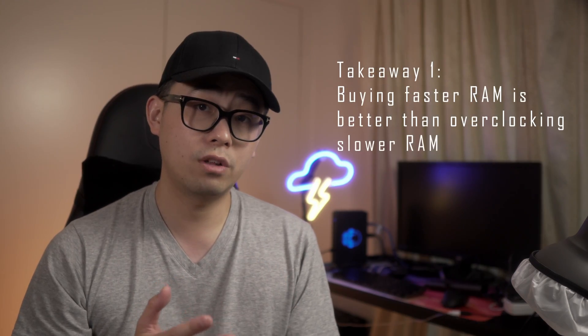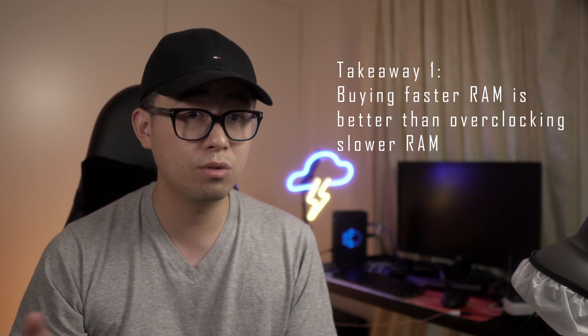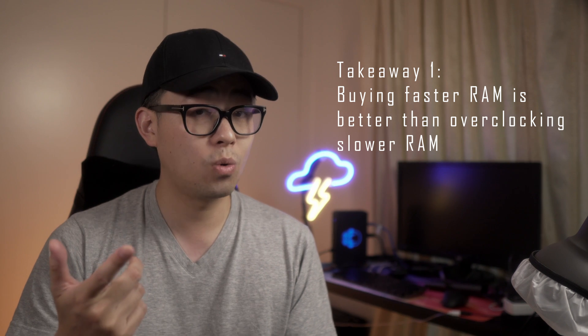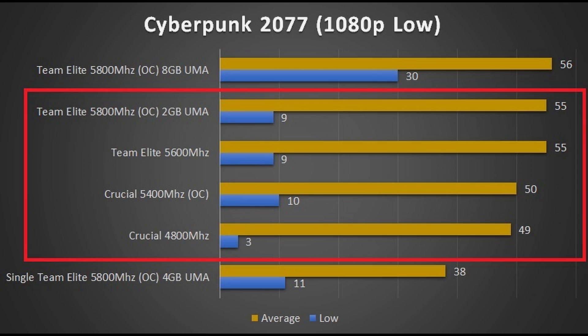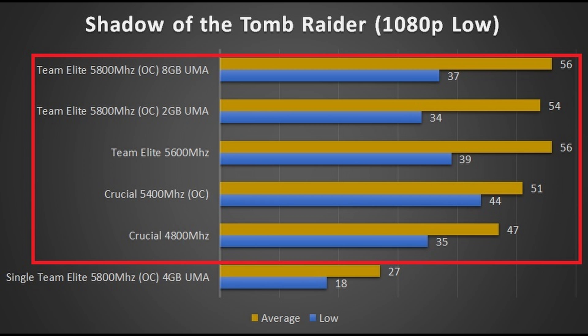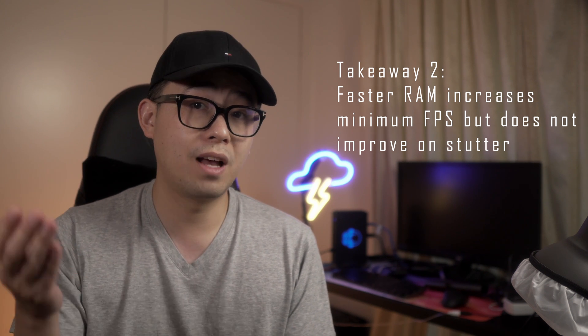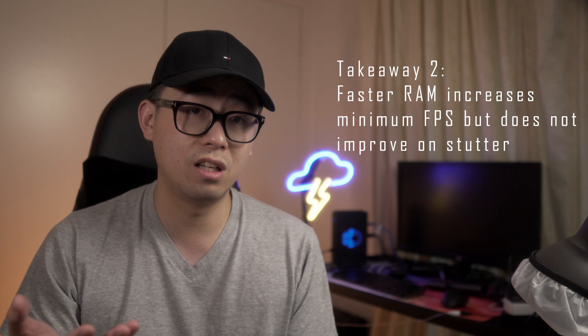In other words, don't expect to overclock your 4800 MHz RAM to 5600 MHz levels and expect the same level of performance increase as buying the faster RAM — that was quite surprising. Takeaway number two: I was hoping for better increases in minimum FPS, which in some titles I did see, but games like Cyberpunk and Shadow of the Tomb Raider, not so much. Given the increase in average frames as well, it does look like it scales in the same way. In games such as Modern Warfare 2, it could be the difference between death and a chopper gunner — I would try to lock frame rates much closer to the minimums, as those big drops from the hundreds down to the sixties are where you'll really notice.